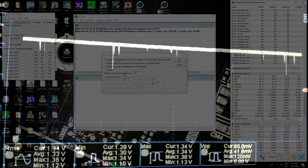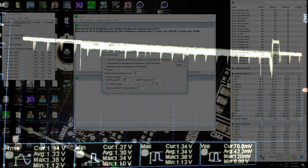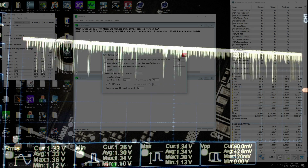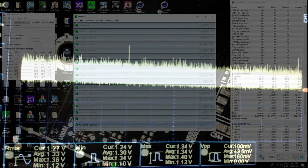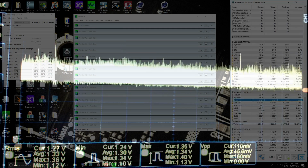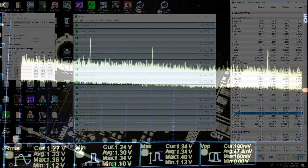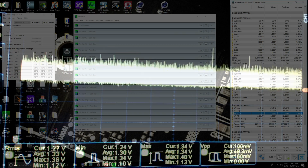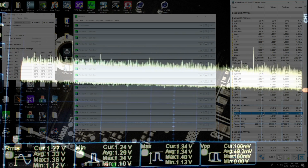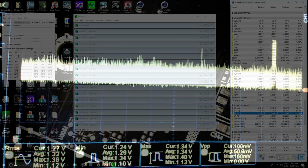I didn't like dealing with it, and so I wasn't a fan. But this thing is great, because we're just gonna punch in 32K, and Vcore is reading 1.284 over it. I think I set it a little bit low. Yeah, I did set it a little bit low. We're getting 1.226. Actually, no, I pretty much nailed it, right? So we're getting about the voltage that I wanted. Actually, it looks like we are a little bit low.